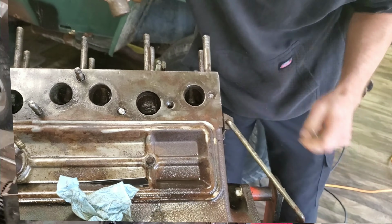Wow. All right, so where we are is with our little center punch, Kyle has started a small diameter hole, and he's going to go ever so slightly larger. Not yet, though. This is still the small drill. I want to get down to the bottom, more deep, and then you're going to go larger diameter after that, correct? Yep, then easy out. So I'm going to let Kyle get a little more deep, and then we're going to go bigger.